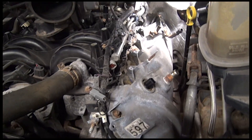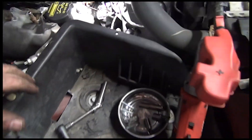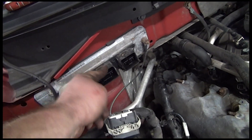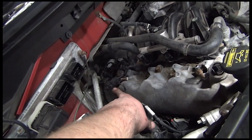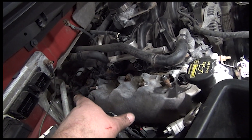Almost two hours into it and I got the valve cover back on. I'm going to do everything in reverse and start working on this mess of a side over here. On the driver side, I pulled the battery out because I had to remove two of the ECM plugs — all you do is pull this big gray thing back and it pulls off. To get the harness down, I had to shove the harness way down here to get the valve cover. It doesn't want to come out of the back because there's just enough room, so the front has to come up, tilt down just a little bit, come out a little bit more, and then it allows the back to come off the rear rocker. Then you can pull it up out.